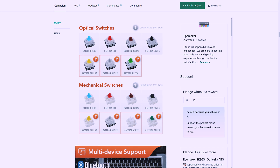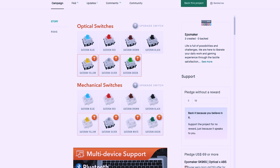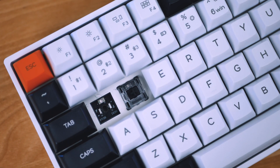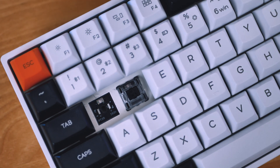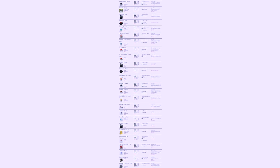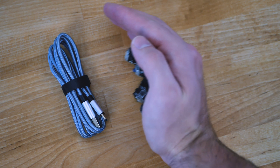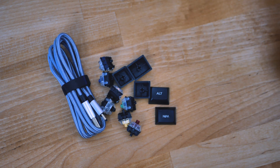As far as switches go, you have the choice between Gateron mechanical or Gateron optical switches — both are mechanical; one uses light and the other uses pins. Both variants are hot swap, which is great. Mine came with Gateron black optical switches, which are great switches. Optical switches have less resistance, are easier to lube, won't require soldering, and you don't have to worry about bent pins. The only drawback is fewer options compared to traditional mechanical switches. Included in the packaging is a braided USB-C cable, a set of Windows keycaps, extra switches, and a keycap and switch puller.